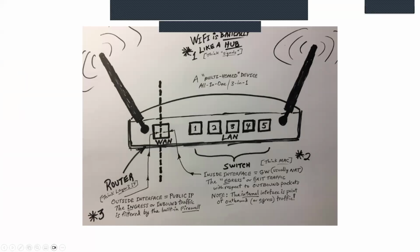So this is the backside of a, oh yes, just as I start. So most Wi-Fi routers for home and small business use are referred to as small office, home office routers. They're kind of borderline professional network equipment. And then there's consumer grade Wi-Fi routers, which are intentionally designed for a residential environment and often have gaming features and share your media features, you know, connect to a USB and turn it into a network attached storage where you can share media kind of thing. So it's sort of media center in orientation, or entertainment and gaming in orientation, right? So you get different flavors, but essentially they all work in a very similar manner.